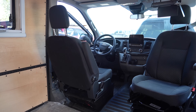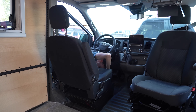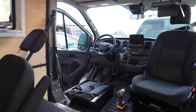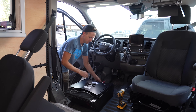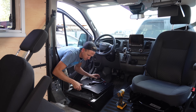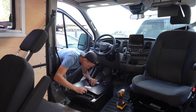The process for the driver's seat is very similar to the passenger seat except for the wiring harness — we'll rip through it quickly and slow down to show anything new. We removed the electrical connection, the factory bolts, and the seat. When we put the swivel in place, we found out that the electrical harness was too chunky to fit, so we had to make a modification. Far Out Ride has a great fix for this in their blog post about this installation, and we're just going to mirror that.